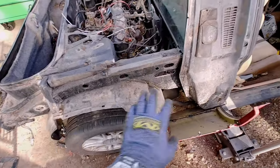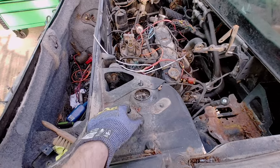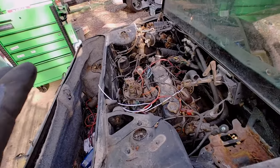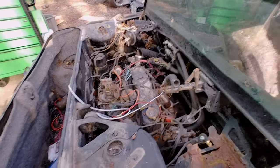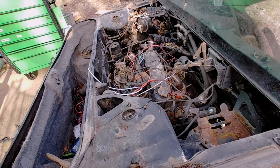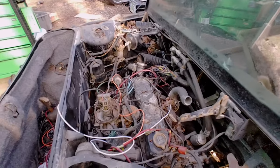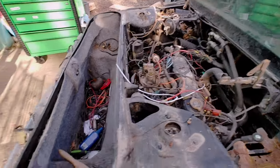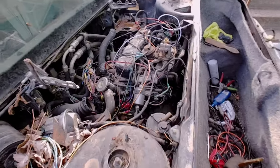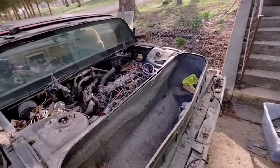Right now the cradle is unbolted, and I've also unbolted the strut towers on both sides. So now all that's left is the hoses and wiring. Instead of using a crane, I'm just going to jack on either side with two jacks and use stands to get this thing high enough. I'll start lifting and taking things out as they appear — most of the stuff I'm not keeping, so even if it's a part I need I'll probably get a new one.